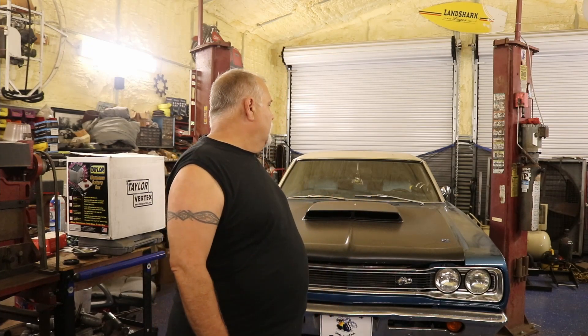Also, I've been having a problem with the car not starting after it gets to running temperature. Like, you start it up, drive it down the road, it gets to running temperature which is 175 to 180, and I stop at a gas station or stop and kill it. I come back out and it won't start. When I say not wanting to start, it's not wanting to turn over — it's acting like it's low voltage or the starter's not coming in all the way. It almost kind of makes me think like it's vapor locking, but I know that's not happening.